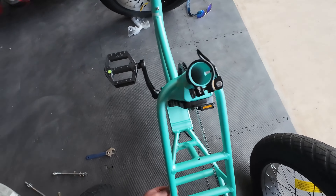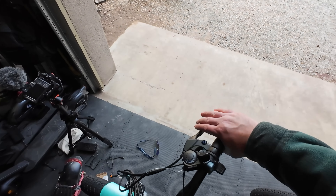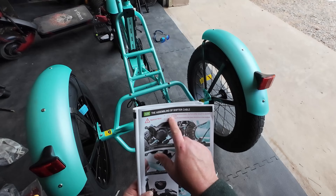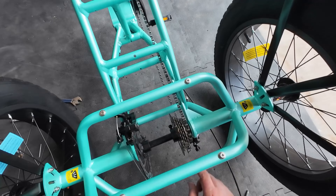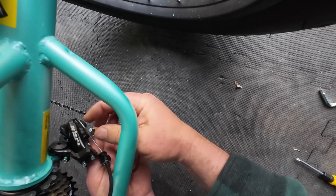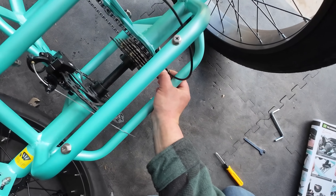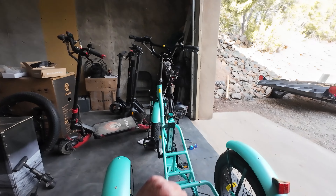I'm pulling the right brake here and that's the rear. For the shifter cable, when installing it should be on the seventh speed up on the handlebars and on the smallest wheel — remember we mounted the chain on the smallest wheel. Run this wire right through that little tab. Cables all installed, and of course they have these little adjusters so if you need to fine-tune it you can always twist this out on the brake or shifter side.